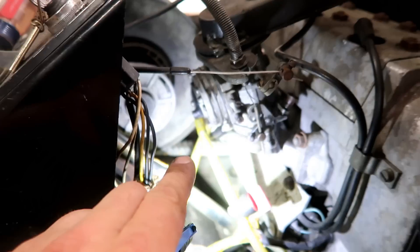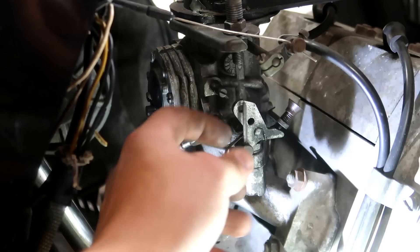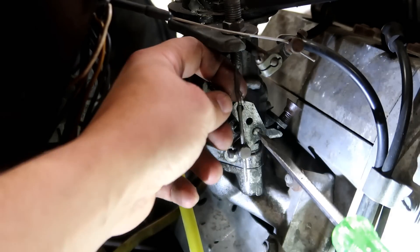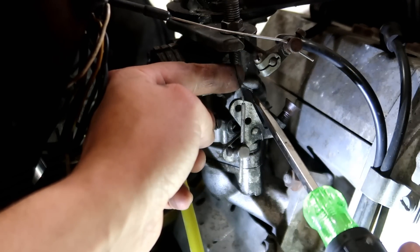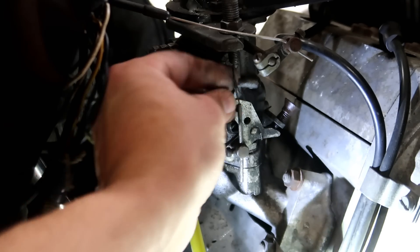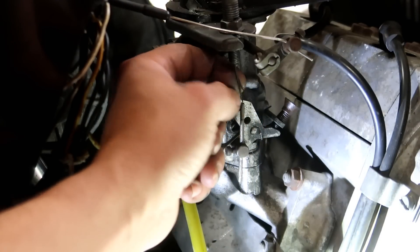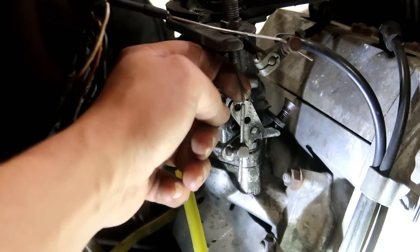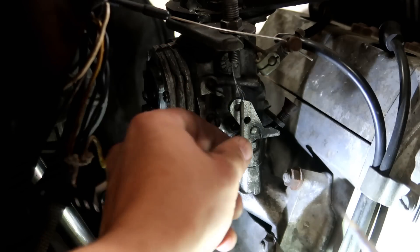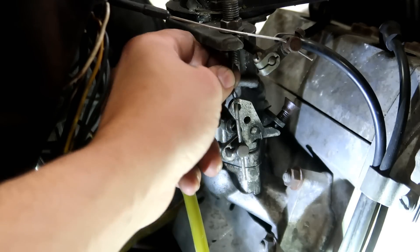I really wanted to get this running for you guys in this video. This is actually a Tillotson carb, which is the same thing as we have in our 340 Raider over here — had a couple of those run through the shop. One thing I just noticed here is the throttle cable is starting to fray a little bit. I've actually had it down to like one strand before and still ran it, but what's going to happen is that's going to break someday and you may be out on the trails and totally screwed. So that's going to have to be replaced at some point.